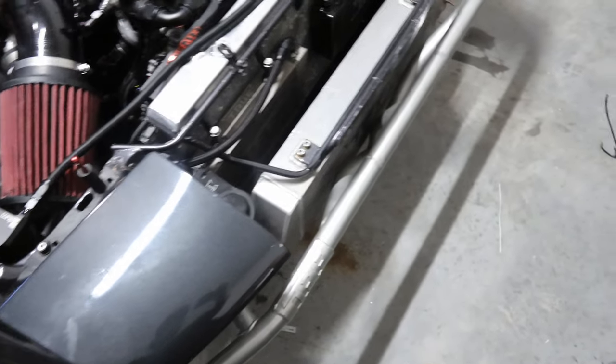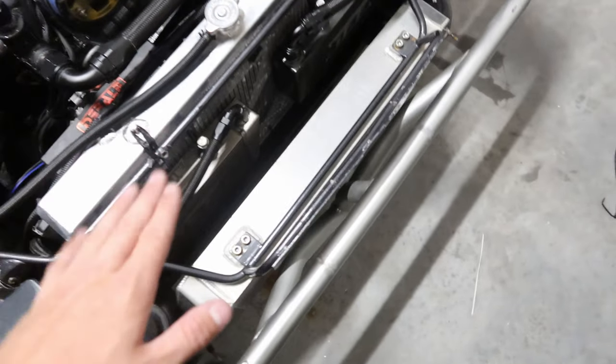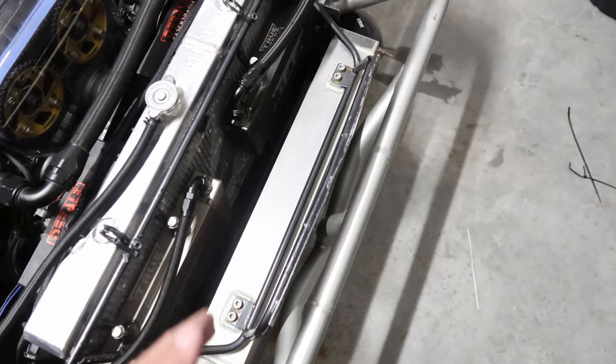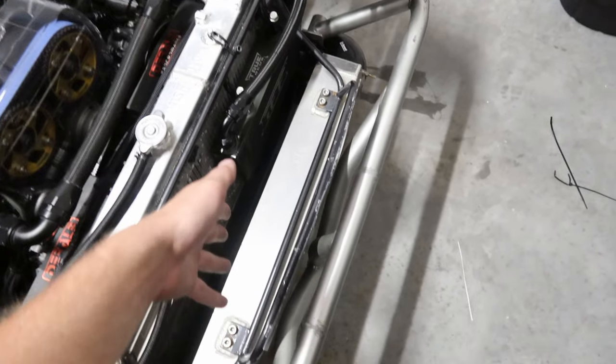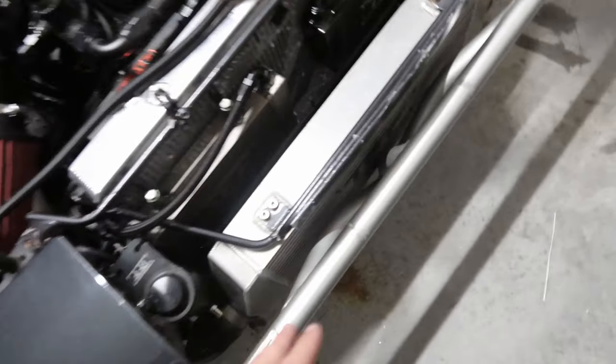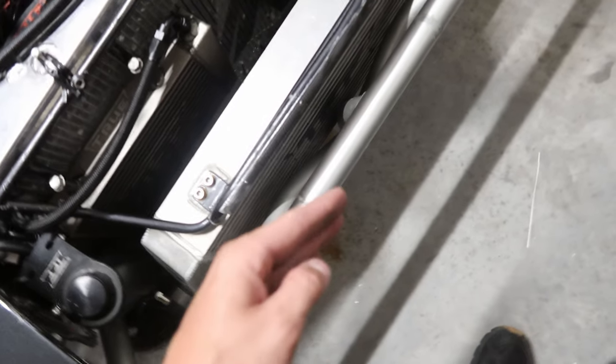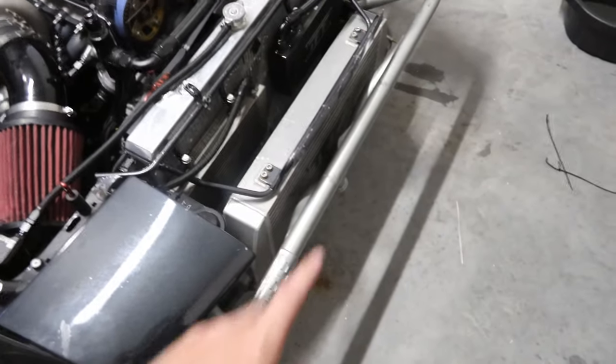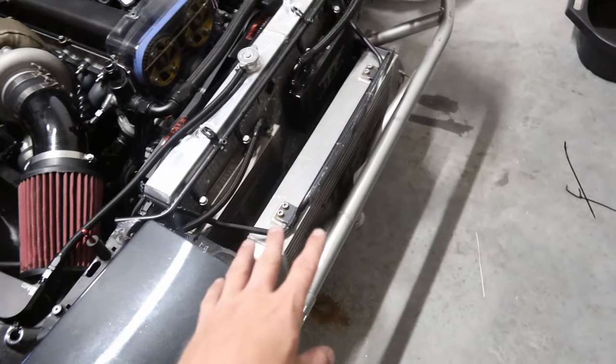So I hit up True Focus Fab. Andrew and I talked for a little bit, and we had the idea to basically make it the same, but just make it come forward a little bit and have more efficiency, to be able to put fans on the intercooler, have more room up front, etc. My idea was to get another bash bar, custom make it, and have the jacking point go straight up and down. That way we have more room to have a bigger intercooler. We also got a new bash bar. I painted it and it's drying in the back right now. Once we get the intercooler on there, we'll be set to put the new bash bar on as well.